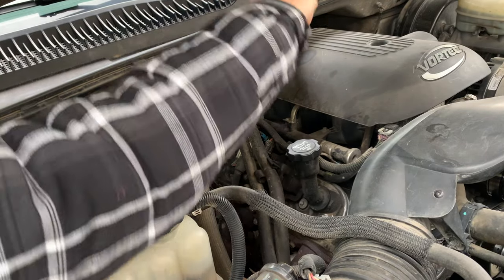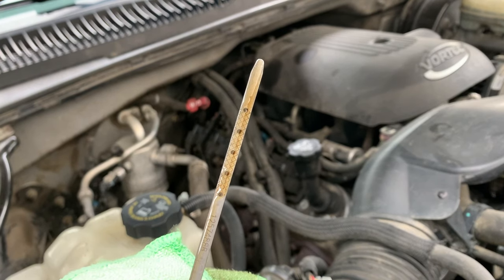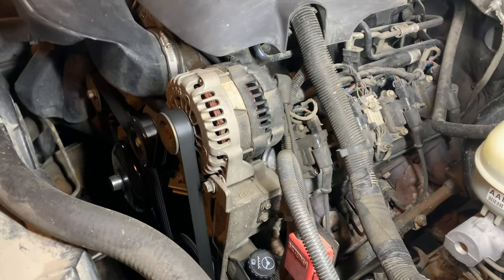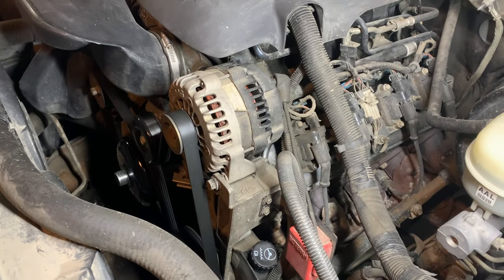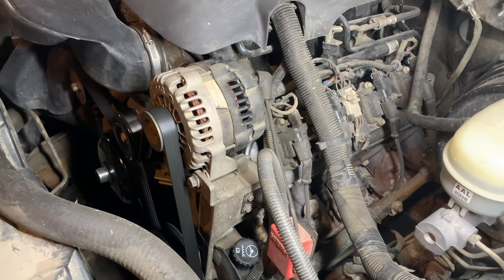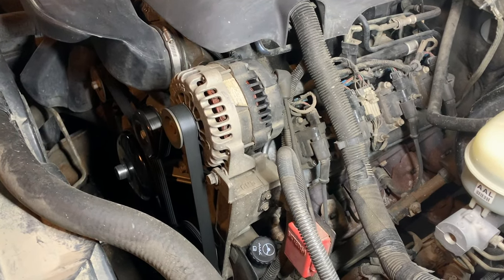About a month later, the engine seems to be running well. It still has that knocking sound here and there. I'm going to show you the oil quality — it's still looking pretty clean, a lot cleaner than it used to be. After doing an oil change anyway, that was my experience with it. It did clean things up a little bit putting that ATF fluid in, and it seems to be a little smoother. It doesn't hurt the engine as an engine flush, so I hope that was helpful for anybody interested in trying this on their own Chevy truck or whatever engine.